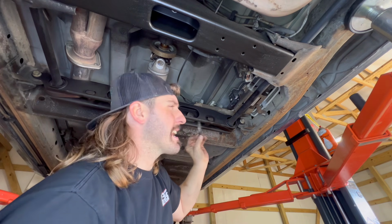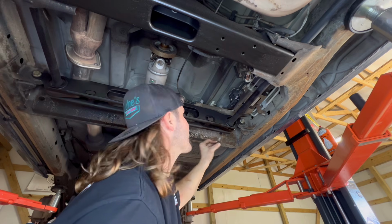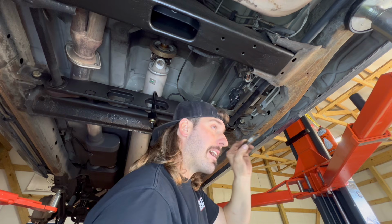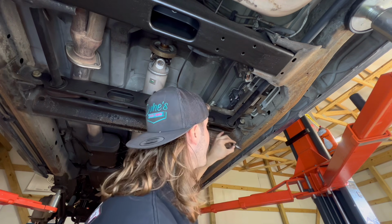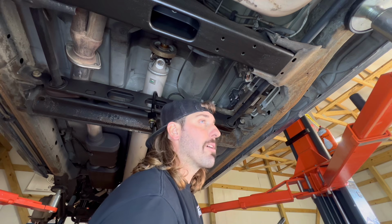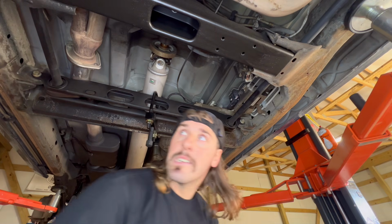Stock height, and it said with this bolt in the stock position, just the key alone will give you 2 to 3 inches of lift, y'all. And I'm looking for 2 with this key because I'm putting that lift spindle on, y'all. If I wasn't, I would look for 3 out of this and 1.5 in the back. That's what I was originally gonna do till I decided to run big wheels. So keep that in mind, y'all. Let me go do the other side right quick.